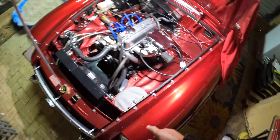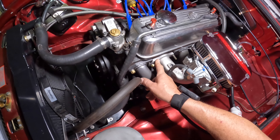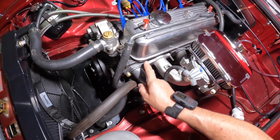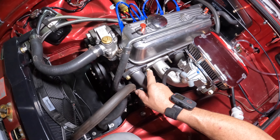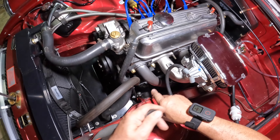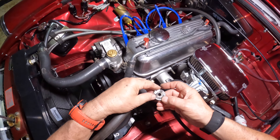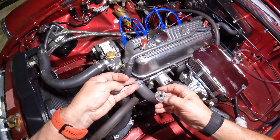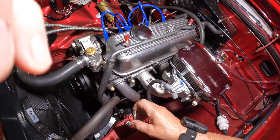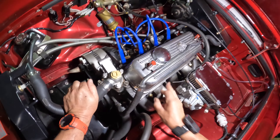So I fitted it and then I came across a problem — the manifold here and the extractor manifold flange, there's two millimetres difference between the two. When I tried to tighten it up it didn't quite work. The two outer flanges were okay but the two middle ones leaked. I've not done my best bit of welding in the world, but I've now put two ribs — let's call them that — so they now take out the difference between the two flanges.